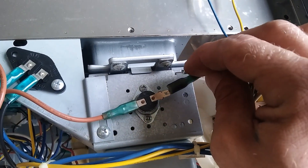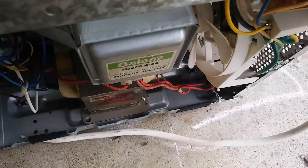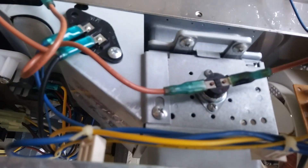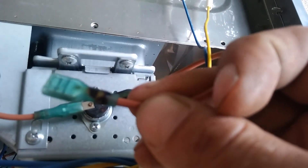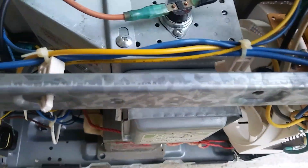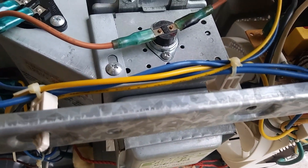Basically, if I just cut this off and replace it with a new one — or I can even just put a whole new wire and make my own wire. This one's not that bad on the terminal itself, but you can see some burntness up here where the wire clamps into it. It was drawing too much current at some point.